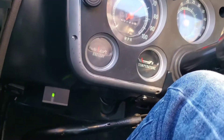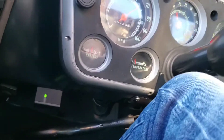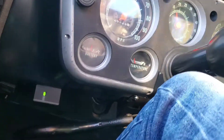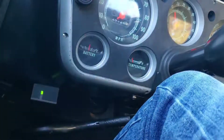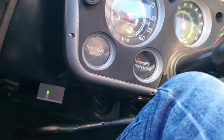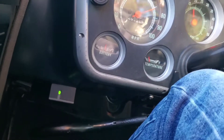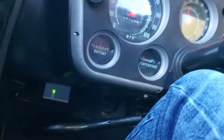Coasting, then cruising gently. The other thing is, if it's locked and I press the gas pedal down quickly but not very far, it will unlock. It's detecting the rate at which the gas pedal has been pressed down in that scenario.